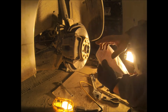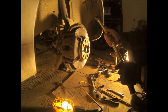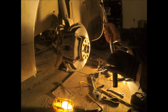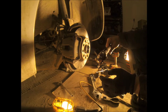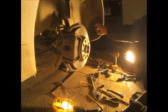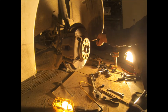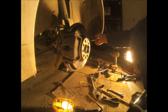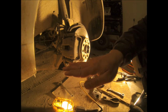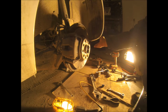So that means set 147, dial in your dial torque bar right here to 147, and when it clicks on 147, you add 180 degrees. So from, say, 10 o'clock, no, from 9 to 3, that's 180. So just half a circle, 180. Yeah, 90 degrees is like an L, plus another to make it 180, which is half a circle.